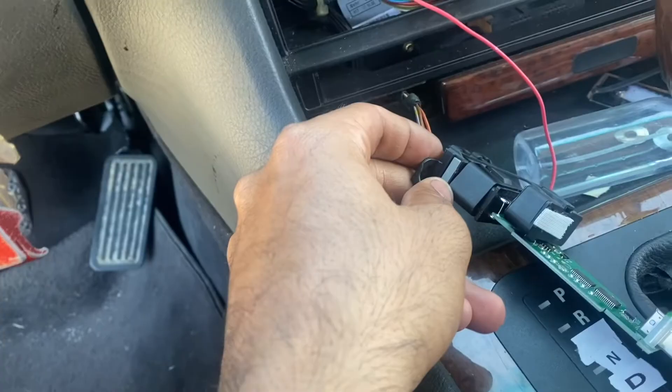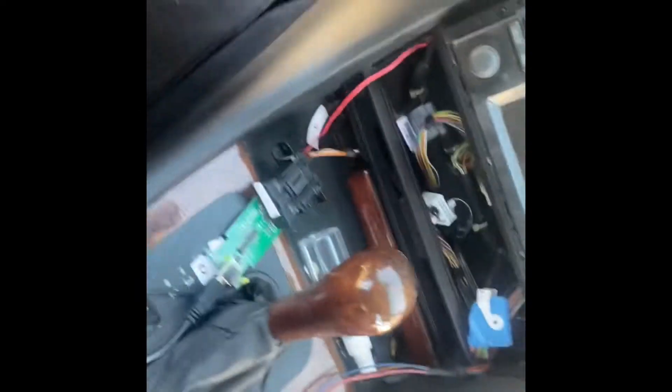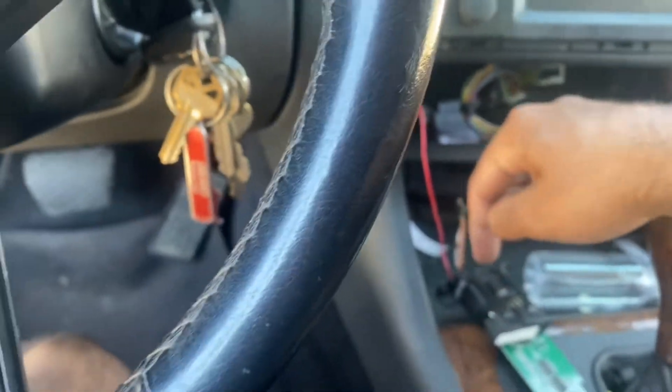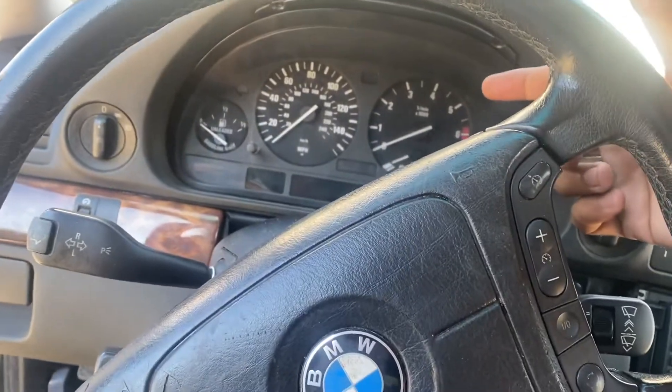What you want to do is connect this wire to the back of pin 8 of your OBD2, which is an empty pin. I just snuck a wire in right here at pin number 8 of the OBD2. Now I've connected this wire to the back of pin 8 on the OBD2 — make sure it's making proper contact with the scanner tool. This red wire comes from the white and purple wire spliced in to make that connection.